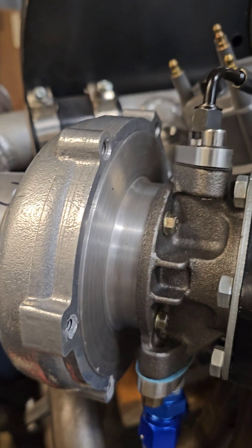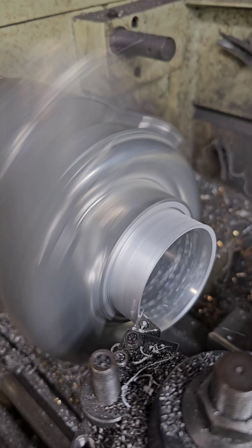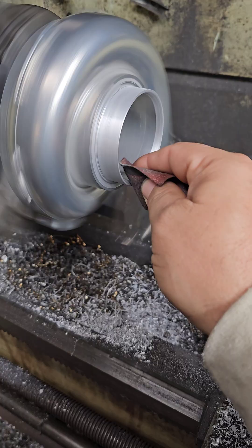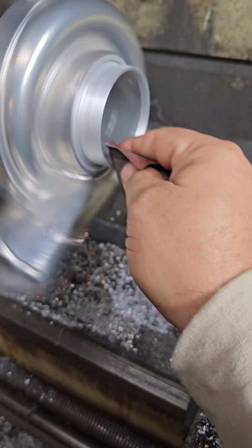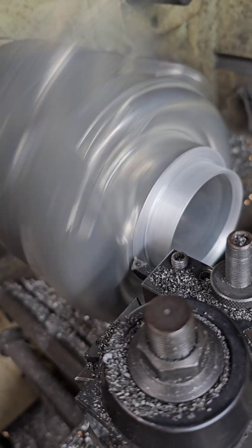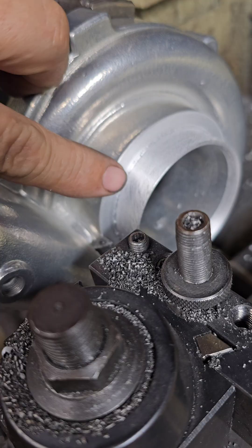I need to do that right now. I just took the bolts out, that's ready. So before I actually commit to it here, I'm thinking about moving it in even closer. Get that outer edge. Because where it's ceramic coated, that's actually where, if you're welding, the bead and the weld's going to lap into that corner there where I'm basically touching. So I've got to clear that out. You can see that little bump there I'm taking away. That's going to blend into that, so it's kind of hard. I'm going to try not to go up this wall.